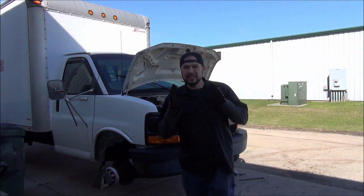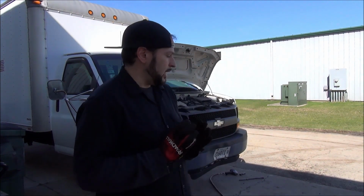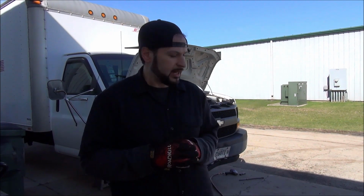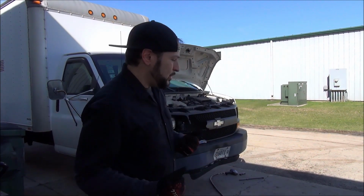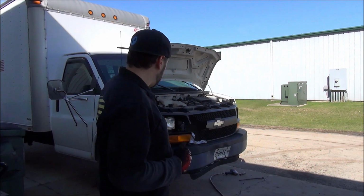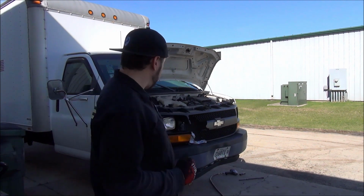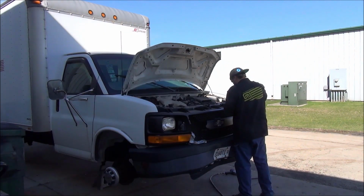Now we're going to have a complete list of the tools you would want in the description. You don't need an impact wrench to do this job, 3/8 or 1/2 inch. However, I do. It's going to make it a little quicker. So if you got access to it, you should use them. Like I say, 2 10 mils on the grill. There's 2 15s on the lower brackets for the bumper, and then I believe the big ones going through the bumper are 21s.